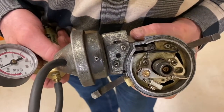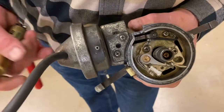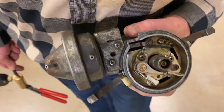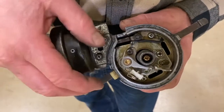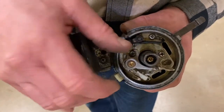That's how ignition timing was controlled on a lot of cars for many years, until things became computerized — the computer now controls that. There's another advance mechanism in there called centrifugal advance. It's hard to see in this one because the centrifugal advance is buried underneath, but attached to this shaft are some special weights and springs.